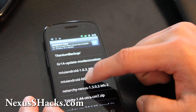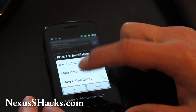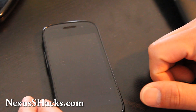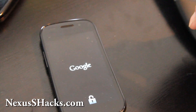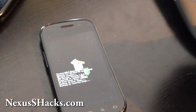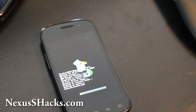Hit that button. We're going to back up existing ROM, wipe data cache, and hit OK. Hit OK and Allow. What this will do is back up your current ROM. My current ROM is the one I just reviewed — that one's called Open Soju.